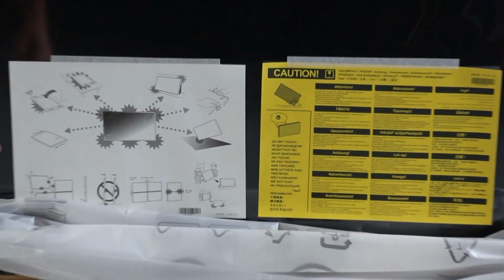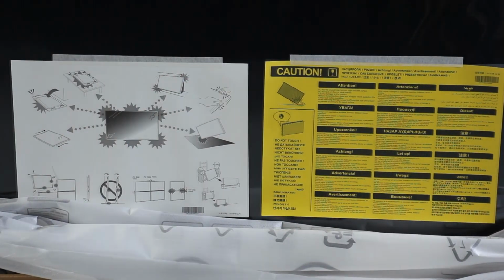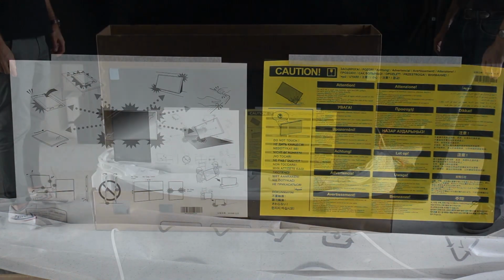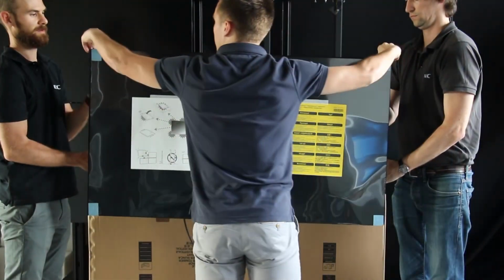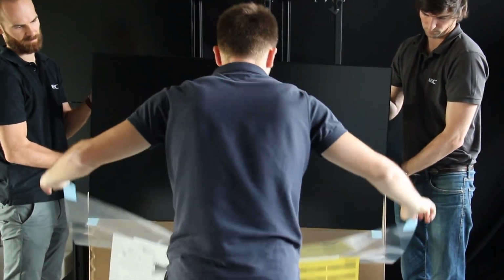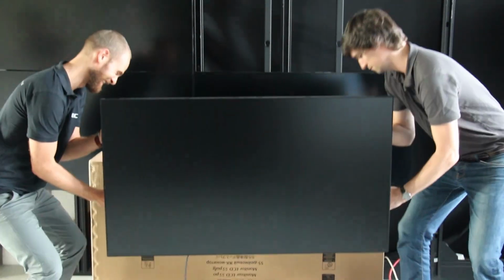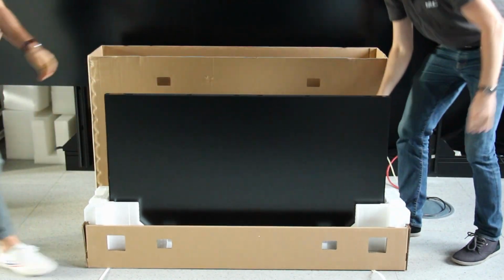At the front of the display, you will find caution information to avoid damage to the LCD due to wrong handling, such as placing the display on the floor outside the carton box or removing the protective cushions too early. Always use the handles of the display and do not touch the front side nor the edges. If you need to put down the display, for example after removing the static bag and the foil, always use the base of the box, which has a protective foam in it.